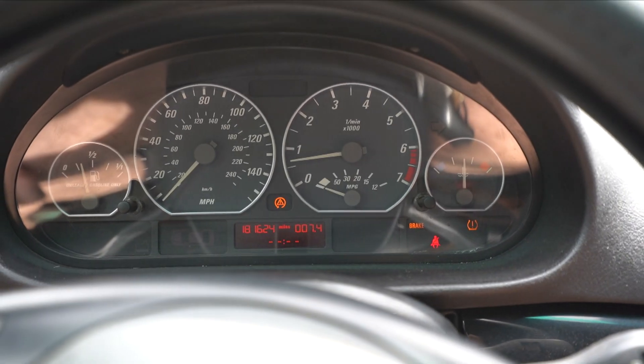If this doesn't work and you're still getting an error, chances are your steering angle sensor is bad. Right now I have the three trifecta lights and mine are all orange. Sometimes one of them can be red, which is something else — that might be your ABS pump or another issue. I'm going to show you how to fix your steering angle sensor if you have the trifecta.